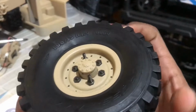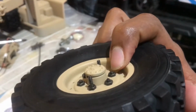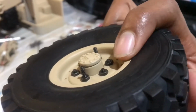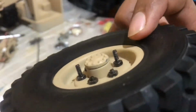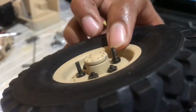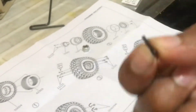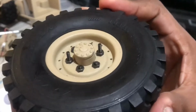Here is the 4 bolts and studs mounted up. Here you can see the height or clearance of the studs. These are the studs that you'll have to do all around, but like I mentioned earlier, the longer ones are to feed it through. So now I'll be removing the 2 long studs and we'll be replacing them with the short studs so that we can finish the assembly.